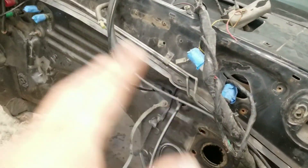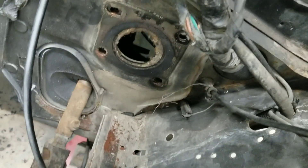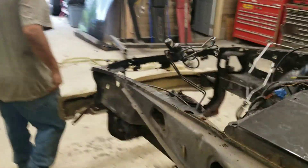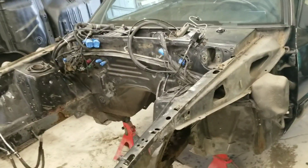Alright guys, the master cylinder and booster is out. We pulled that pin exactly like I said. Three of the four bolts you can get with the ratchet wrench — the top one you can use a long three or four extension through the dash to get to it, because you can't get a ratchet wrench on it. Then it'll just slide right out and drop. I pulled that undercoating off of this area here — you guys can really see how bad that is. It's gonna need a little bit of a patch. That pretty much concludes this video.